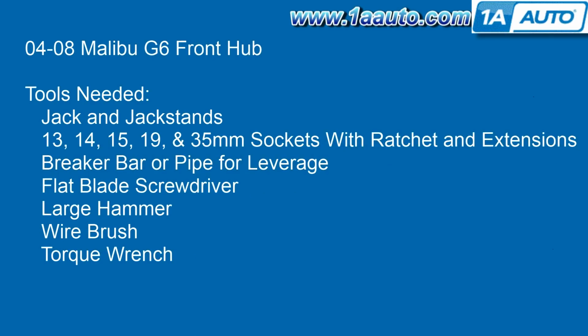Tools you'll need are jack and jack stands, various sockets, 13 to 19 millimeters, plus a 35 millimeter socket with ratchets and extension. You'll need a breaker bar or a pipe for some extra leverage, flat blade screwdriver, large hammer, wire brush, and a torque wrench.